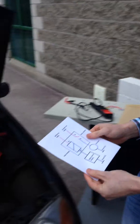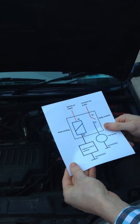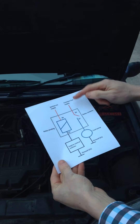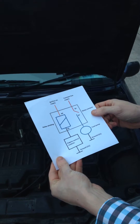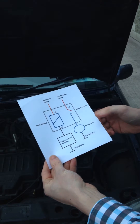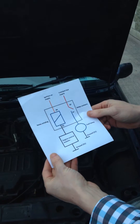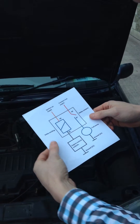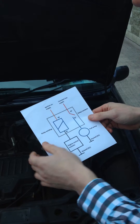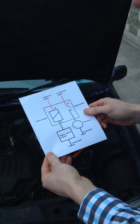The best location to test the fuel pump circuit is at the fuel pump relay. Manufacturers often use the DIN SPEC for terminal assignment, where pin 30 is the constant live from the battery to the contacts of the relay, pin 87 is the output to the load — which in this case is the fuel pump — and terminal 31 is the ground circuit. On the control side of the relay, 86 is the supply from the ignition, and 85 is the control for the winding, grounded through the module, again through terminal 31.